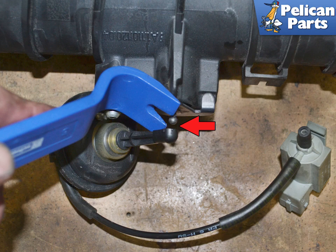Clean the resonance tube and intake manifolds as best you can with a lint-free cloth. Lightly spray both rubber sleeves with silicone spray — when installing them you should be able to pull them completely around 360 degrees the resonance tube once installed. The stop bead must be seated between the tube and the intakes. Always replace the self-locking screws and torque them to 4.5 Newton meters or 3.5 foot-pounds.